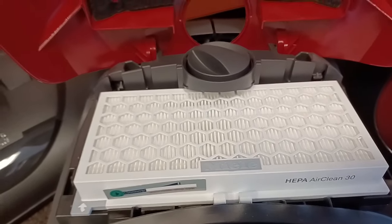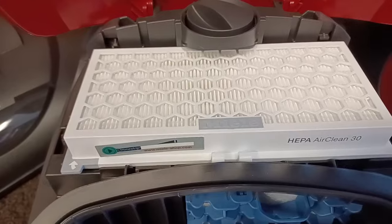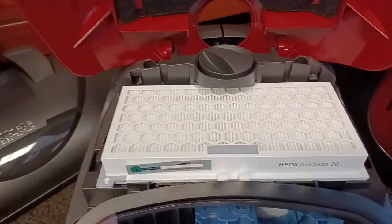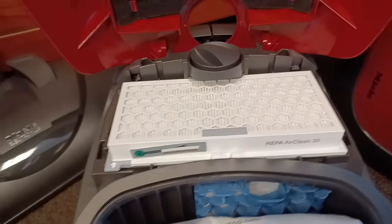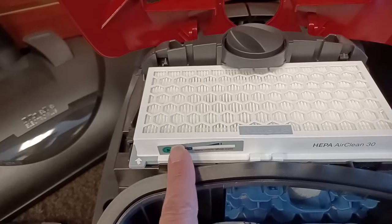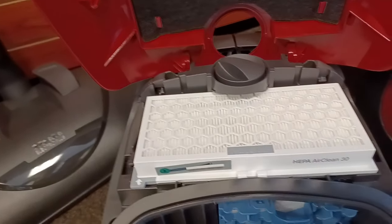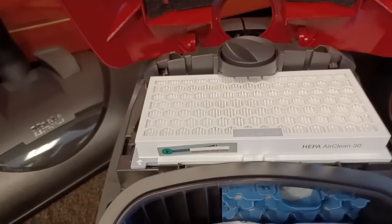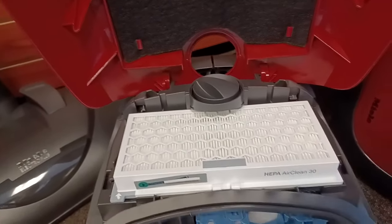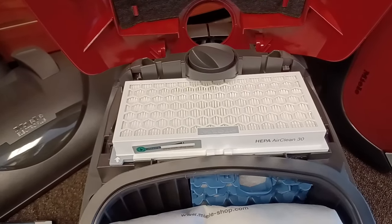Again, like oil changes, you can go by time or by actual mileage — and the time strip represents your mileage. For instance, if you had three vacuums in the house and only used your Miele a third of the time, this filter can last a bit longer. What we see more often is that people use their Miele a lot more than average, especially in pet households or allergy households — maybe two to three hours a week. This is where the time strip is really helpful because it shows you your actual usage. This filter might time out in six, eight, or ten months — not quite a year. You also want to replace it by time because even if it's not filled, it's decaying biological matter and a source of odor, so you want to get rid of it anyway.